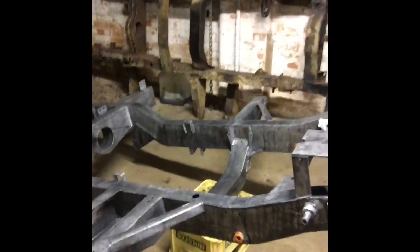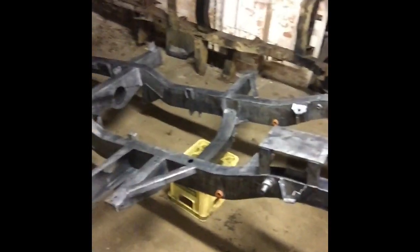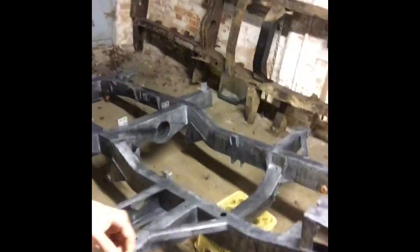When you paint the mordant stuff on, it turns the entire chassis black, and then it dries to a white powder. Then you've got to wash it off - ideally a jet wash, a really high pressure jet wash. If you haven't got one of those then you have to scrub it off with a brush, and that took quite a long time, maybe about an hour and a half with two people. You can see it's like a mottled grey colour.